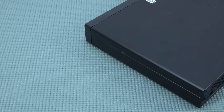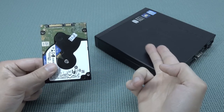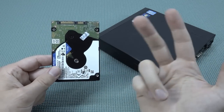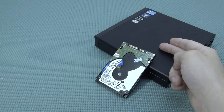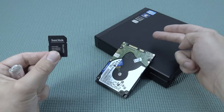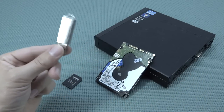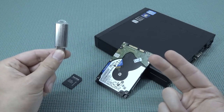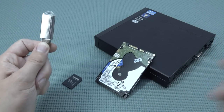There are some things you need to know before getting into this. You're going to need a hard drive — these devices support most of the time 2.5-inch drives. 2TB and bigger drives are very cheap to buy, and if you go with an SSD that's going to be awesome but also expensive. Alternatively, if this device has an internal card reader you can use an SD card, or you can seriously just use a thumb drive — format it with Batocera and put all your files on there. Even a small 16GB one will work if you just want to play some retro stuff.